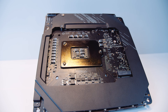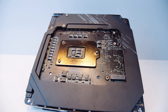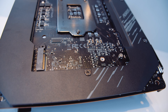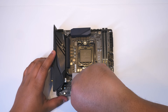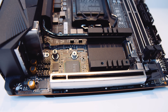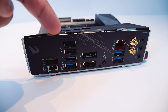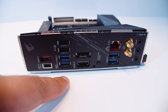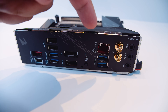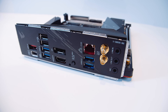If we flip the board over, you'll see it has a full-cover backplate — pretty good for an ITX board for a little extra heat dissipation. On the back of the board there is another M.2 slot, which means you can have two M.2 drives. If you flip back over and remove the giant heatsink, there's another heatsink and another M.2 slot underneath. So two NVMe M.2 slots in total — excellent for a miniature workstation build. On the rear IO we've got USB Type-C, lots of USB 3.2 ports, DisplayPort and HDMI 2.0, a Q-Flash button for flashing the BIOS, 2.5 gigabit Ethernet, Wi-Fi AX connectors, audio, and an integrated backplate.